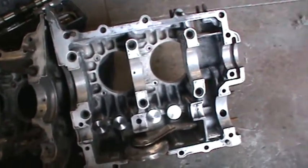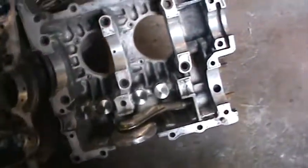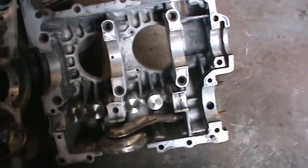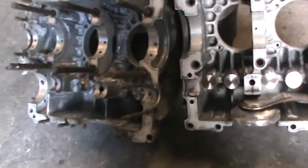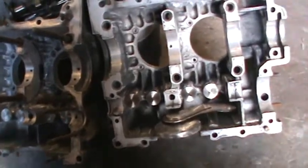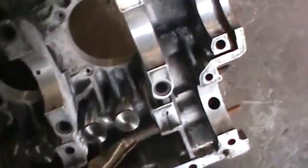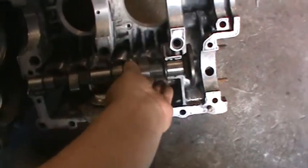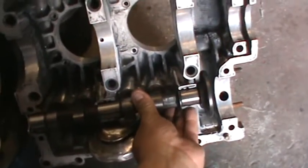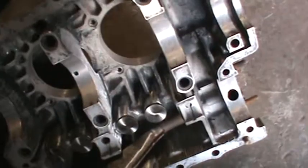Back on the 1600 - I'll show you a couple things. We got the inside of the case deburred and ran a sander through there because this case had some porosity in it, so I was trying to knock all the porosity and dust loose. We got our scat lifters installed in there, we got plenty of clearance. You can set the bearings in there and check it, or you can gently set the cam in without the bearing and check your clearance - we got about 48 thou without the bearing.